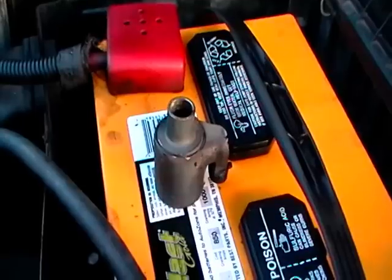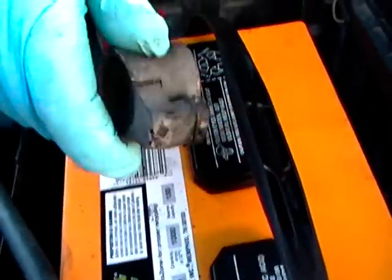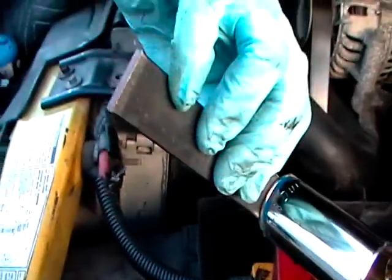All right, I put a little rag underneath the valley there. Now that we've got that part off — and you can do it with a 3/4 inch socket — this little part here you just have to finger-loosen counter-clockwise, and then part of the valve will come out. So we got these two pieces off our sensor. Now all that's left is the bigger nut, which we're going to use our custom tool for, and hopefully it'll work.